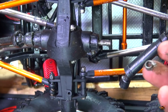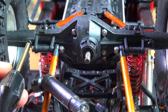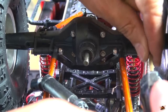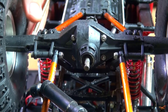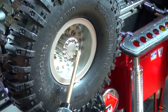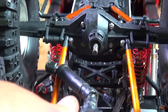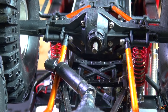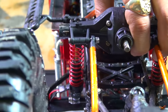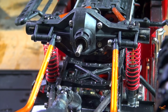Hopefully it hasn't broken my gears. I'm going to have to take apart the whole thing and have a look at it. Just going to get on the inside with a Phillips here and undo the four screws. Now these rims I have on here — you actually have to do quite a bit of work just to access the inside wheel nut where you can tighten it on the axle stub. All of these little screws have to be undone so you can take the cap off. Wiggle, wiggle, wiggle — axle removed. A lot of you already knew that, but maybe some of you didn't and it helped. That just avoided a lot of work.